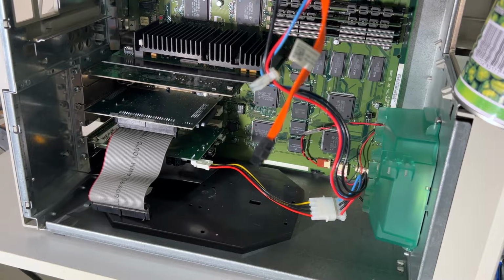The Radeon 7000, however, if the PRAM is reset, it'll just boot headless, as in there'll be no video, but the machine will continue booting perfectly fine. At that point, you could go over to the keyboard, hit the power key, hit the enter key, and shut the machine down and reboot it, and then it'll come up perfectly fine. So very much a better thing all around for this system without having to deal with the Rage 128 being weird. So up from that, we have the big cheese of the whole upgrade situation.